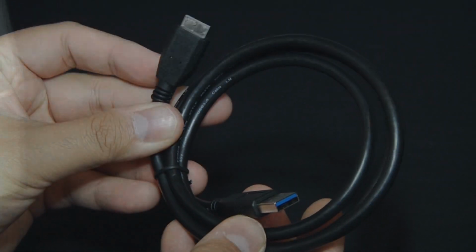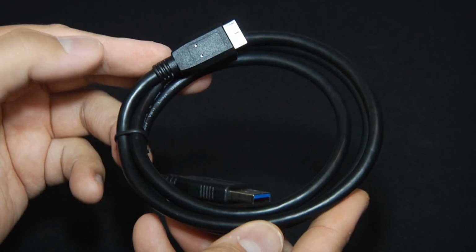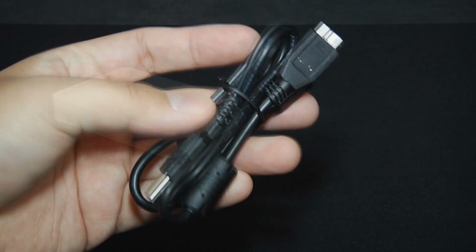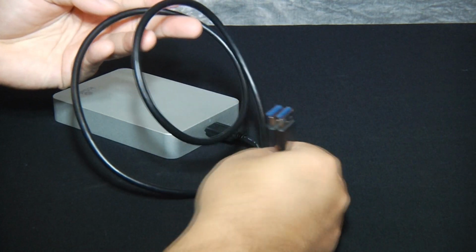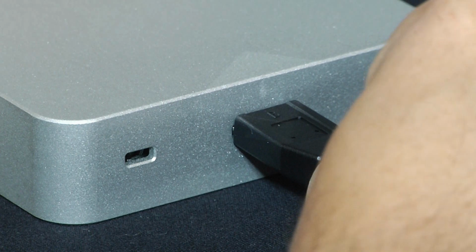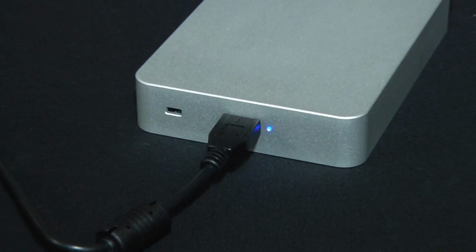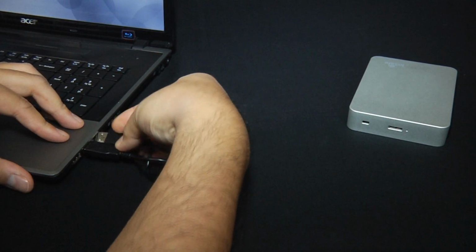Out of the box, the Rugged Portable has everything you need to connect your drive and protect your data. It includes both a USB 3.0 cable and a USB 3.0 to 2.0 Y connector. This is important since we were not able to get the drive powered up in a USB 2.0 port using the USB 3.0 cable, and using a USB 2.0 cable in a USB 3.0 port would result in greatly reduced transfer rates. In other words, use the cable that supports the fastest USB ports on your system.